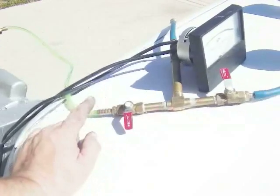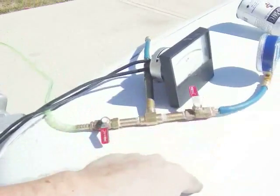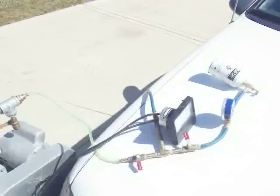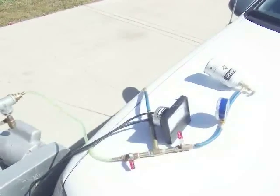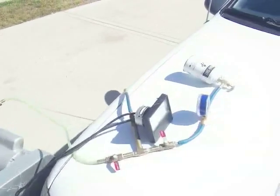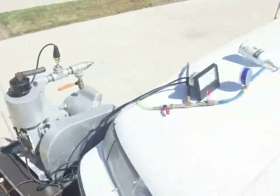There are a couple of things I skipped in this process. You're supposed to change the barrier hose between components and also replace the dryer accumulator and orifice tube during a conversion. I didn't do this — this was done on the cheap and against normal conversion protocol. It works, but there are some drawbacks. I just want everyone to know that. Good luck with your attempts to do the same thing using equipment like this.